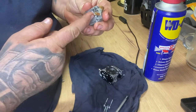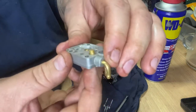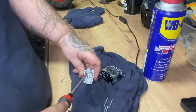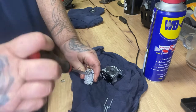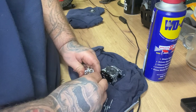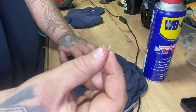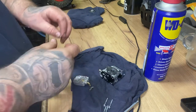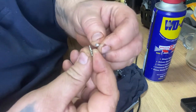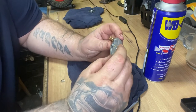This is what lets the fuel through. When it's upside down like that, it lets the fuel in and out of your jet. So basically we're going to take that out. Be careful folks, because there's a little tiny spring and that's got a tendency of going off. There's the little spring - the little beggar - so we'll put that over there. And then you've got your jet.